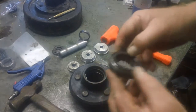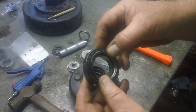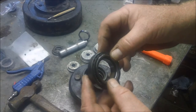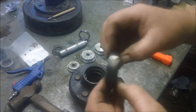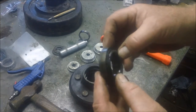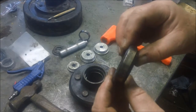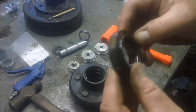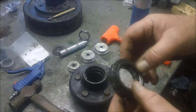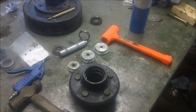So this bearing set, in my mind, is really gone, and it's not dead from wear. It's not what killed it. What killed it was just sitting there for a long time, and just a little bit of electrolysis eating a little bit into the races. This was a Timken brand bearing. Wow, made in USA. This is a much better bearing going out than what's going in. The only problem was, you know, it just sat too long.